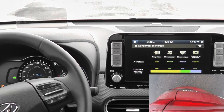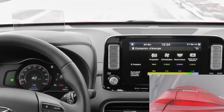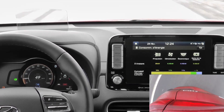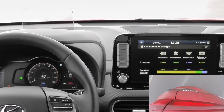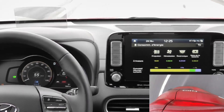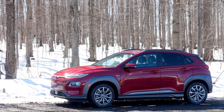Now let's try sport mode to see how that's going to go. I didn't try all the speeds, just a couple of them. At 40 kilometers an hour more or less, release — nothing happens, doesn't light up, because I don't feel the car slowing down as much. At 50, same thing, nothing lights up. In sport mode, when we release the accelerator, we can see that the car doesn't decelerate as much as in regular mode, even though it's in the same regen level. That's why the brake light doesn't light up.